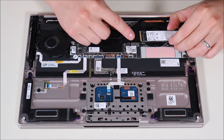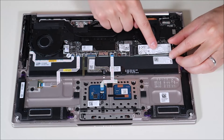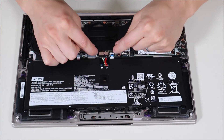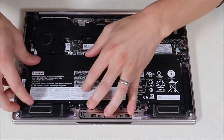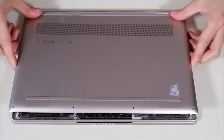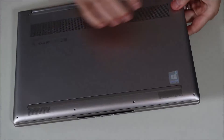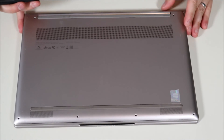To put things back in, there's a long port and a short port on the SSD — slide it back in nice and secure, nice and level, then push it down and replace the screw. Bring the battery back over, line up the plug, and use two fingernails on either side to push it back in. Set the battery in place and put back in the battery screws. Bring back the bottom case, push down on the edges, and put back in the four small screws at the front.